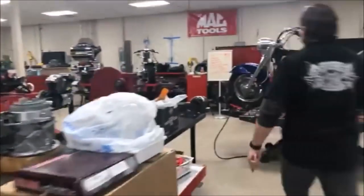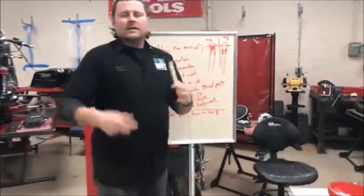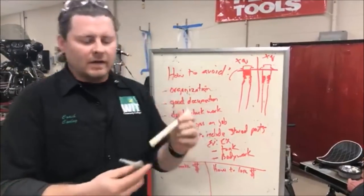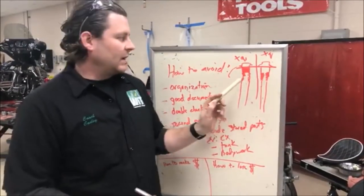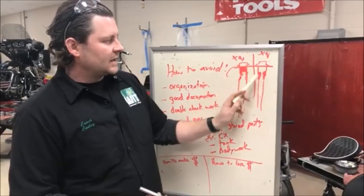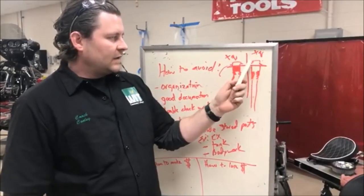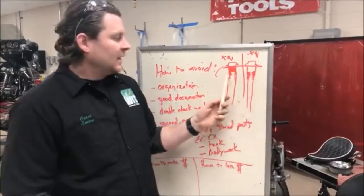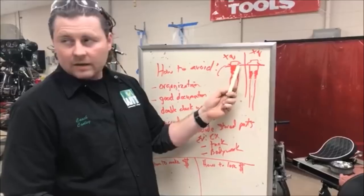Let's go to that whiteboard. Remember I drew that little drawing to kind of explain it? So this is just talking about any nut and bolt. I understand there's a lot of room in here, but we're talking about theory to where we know that oil will not compress. So let's say you're working on a bike where you didn't have a lot of room in there and they wanted you to oil it and you put oil in there and it filled that capacity. You can see here that when, here's a stud, here's the bolt. When done right, it's going to take that shoulder and clamp that down, compressing that gasket or that cover, and it's gonna be done right, right? If you had oil in there to where it hydraulically locks, you could see where the bolt shoulder won't hit the part that it's supposed to compress.